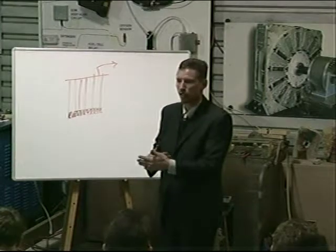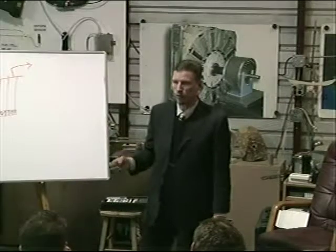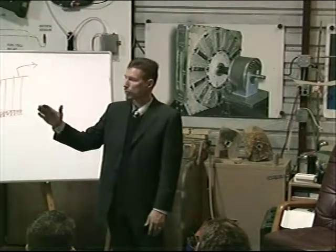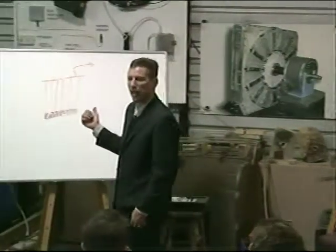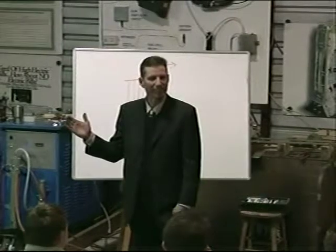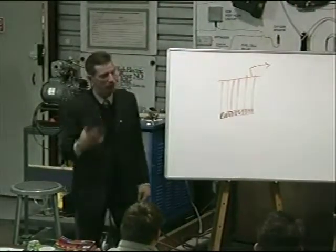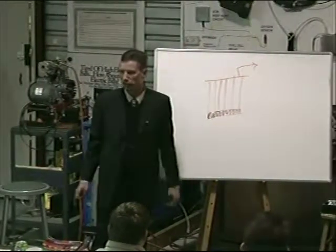It conducts electricity better. So the old trick on the early models, if any of you are familiar with the early ones that had the little amp gauge: that thing doesn't move until you're bone dry, and then it just zeroes out. So it's not like, well, it's drawing 15 amps now, and when it gets down to 12, I'll add water. It doesn't work that way. So you have to visually do your water level inspection on these periodically.